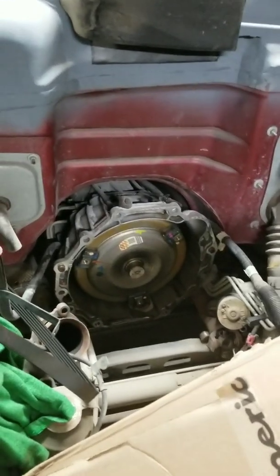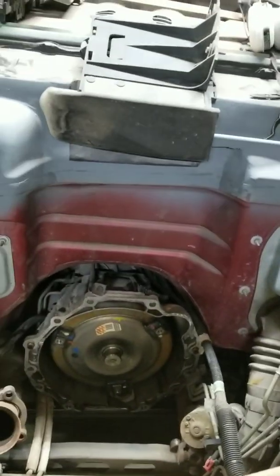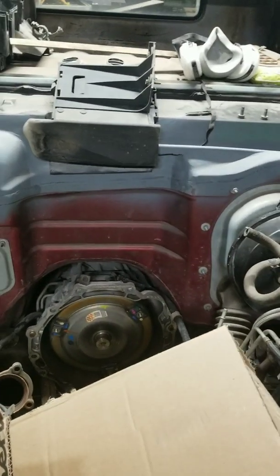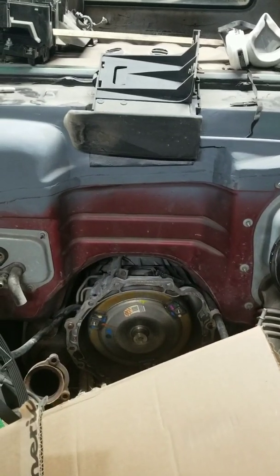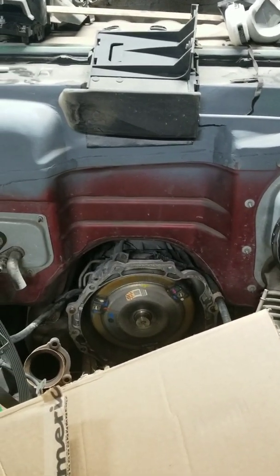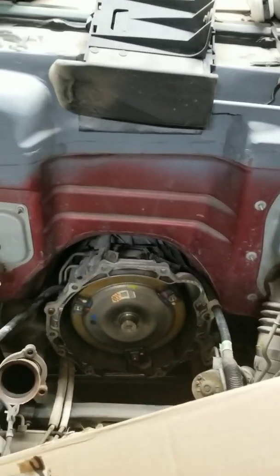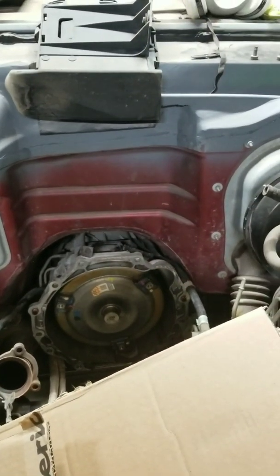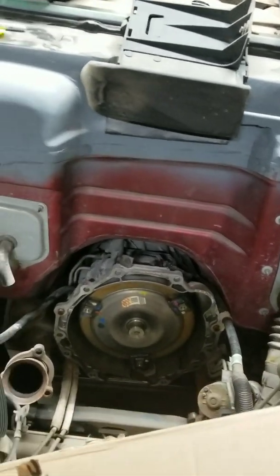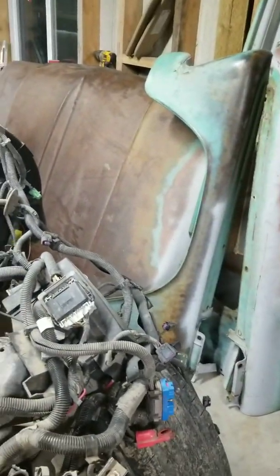Motor's out. This had the 4.2 liter straight six in it, ran really good. My son found a Trailblazer that had a bad motor in it and asked me, 'Hey dad, what are you going to do with that motor?' I said, well, I was going to drive that rig for a while with it. You need the harness, you need all kinds of stuff to put the 5.3 liter in it. So we just yanked the motor out and stuck it in that Trailblazer for my son and daughter-in-law, and they're just as happy as all get out. That kind of forced me to make the decision to do the V8 swap.